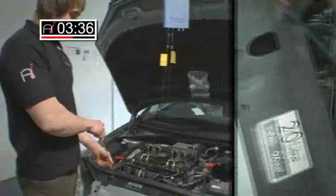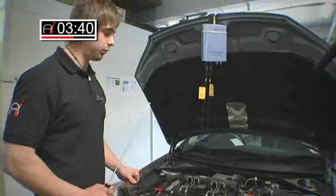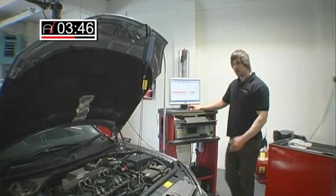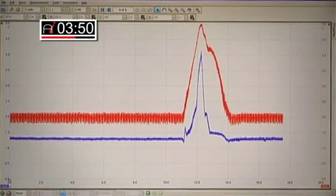As you can see I've got a big split now — the air is just going to come straight out and hopefully we'll see the result. Just to refresh your minds: from the good test we had around 5 volts on the air flow meter and 4 volts on the fuel rail pressure sensor — very good results, just as expected.